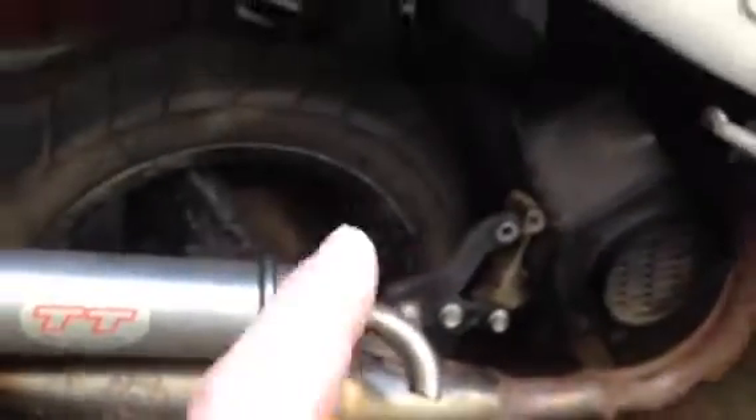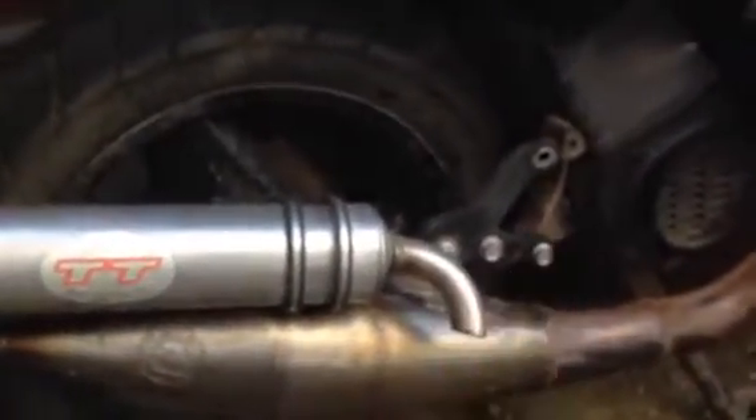And I've got another one. So this one with a Leo Vince pipe already on it, lovely back tyre. I've done a compression test on this one already - the variator is good on this one. So basically this one is going to be a donor - engine out - and obviously I'll put this one in. Now, these engine bearings are good in here. So what I'm going to do is take the engine bearings out of this one and put them in the black one and see how they go. The seals have gone but the engine bearings haven't.